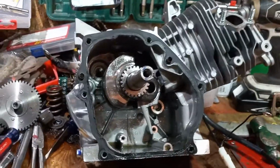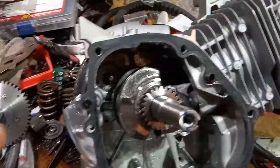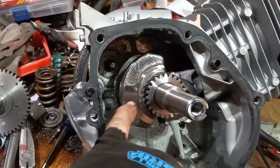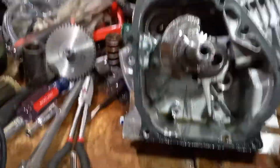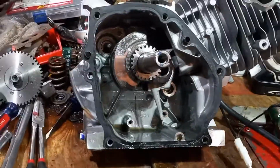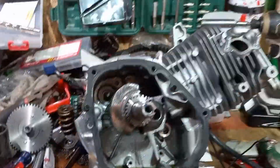Lots. But making sure that your tolerances are right is really important. Right? Making sure that you're micing your cam to make sure your cam lobes are right. Making sure that you're checking the journals on your crankshaft. Making sure that you're taking the time to clean everything properly and making sure that nothing is cracked. I mean, you really got to look at this stuff, guys.